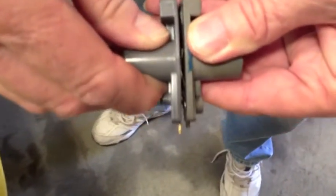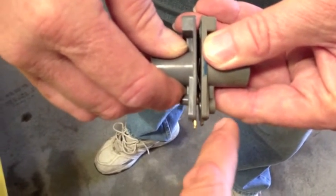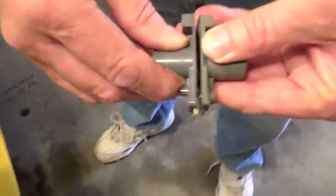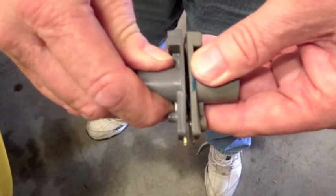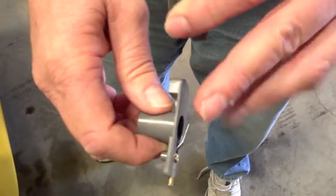Look at these rotors lined up to each other — look at the distance between the tip of this and the tip of that. This is a great way, a very inexpensive part: get a new rotor, put it up against your old rotor, especially if you just bought the car. Wait — this is the wrong rotor. They're two different rotors. What I'm saying is you can't take a car that uses this rotor and put the other one in it, because this is too short. You'll have arcing across it. Yeah, but we got a new cap and a new rotor, so we should be good. This is the second time we've seen a car not run right because of a different length rotor. So this is the new one we're theoretically going to put in, and this is the old one we're taking out. I think this one's a little too short and it probably should have had the longer one in here.